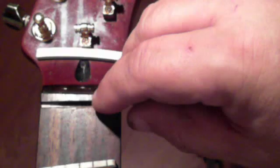Now, once I've shaved this nut with some sandpaper, because it's too wide, I'll dry fit it into the hole, and put the strings back on the guitar, and I'll use this tool to score the center line of the strings, all 6 of them. But I won't cut against that. I'll actually use a caliper to make sure the distance between those 6 score lines is equidistant. Make any adjustments I need to make. Does it make sense? Try to keep it simple and make sure it works right the first time.